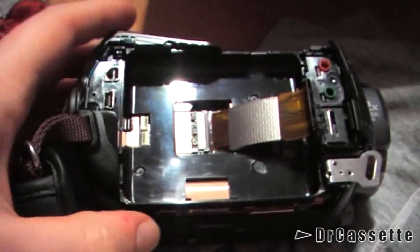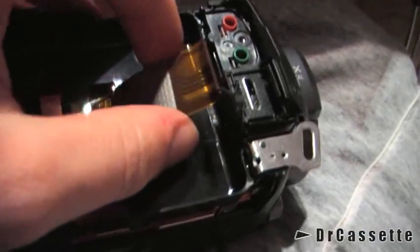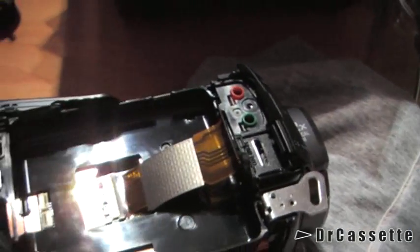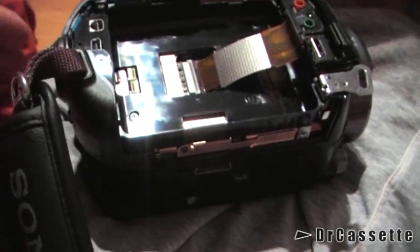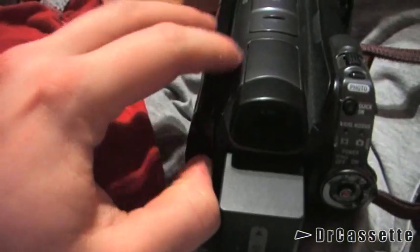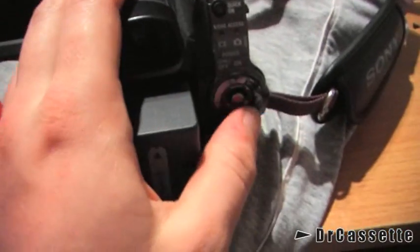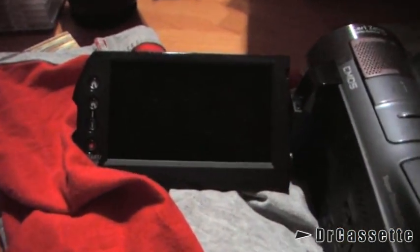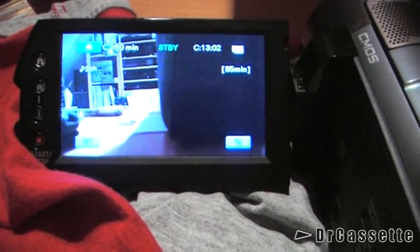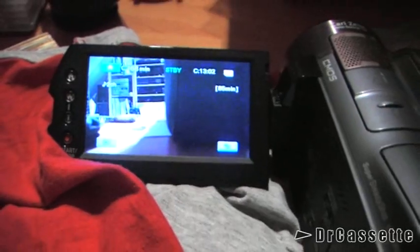And here we have the empty camcorder — well, it's not empty. You can see all the electronics behind it. I've stuck something right there because there is a screw, and I definitely don't want anything shorting out against that. We're now going to put in a battery and see if it still works. It hasn't been doing anything yet — I guess that's a good sign. Of course, it's turned off. Let's turn it on and see what happens. We are getting an error: C1302. So it definitely does need the HDD to work, as it seems.